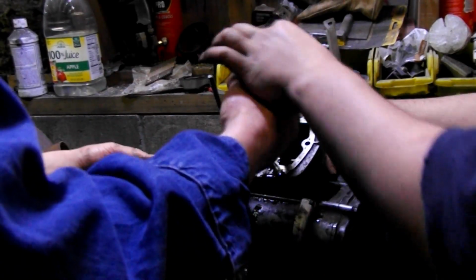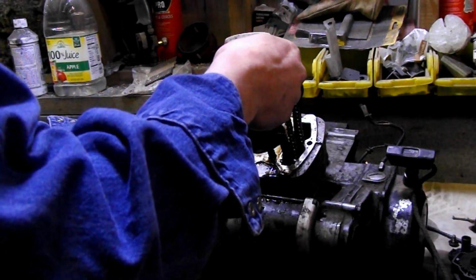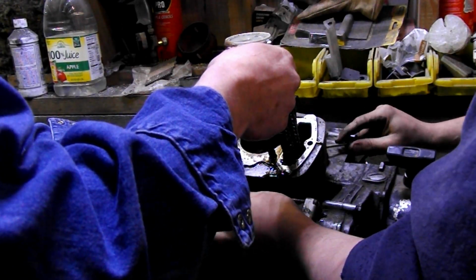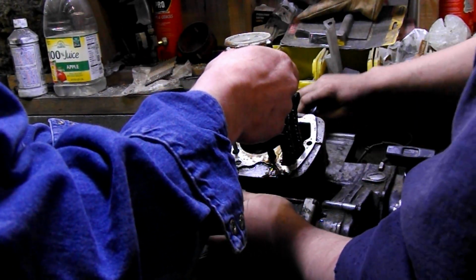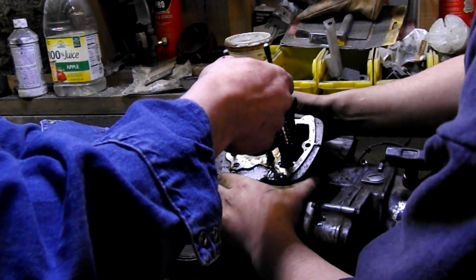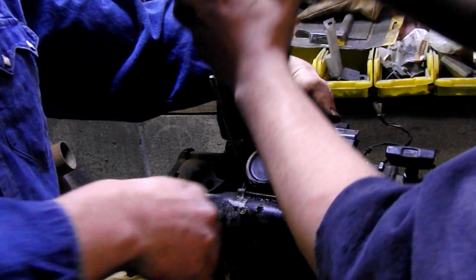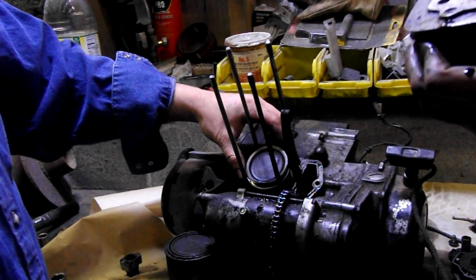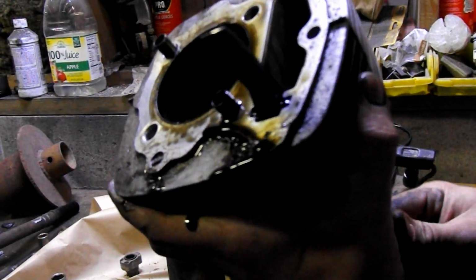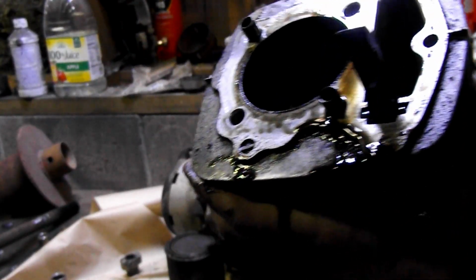Hold the chain. And the whole cylinder is held on by the power of super glue and some kind of superhero, probably. If you're prying on it and you happen to break off one of these cooling fins, a little chunk of it, it's just going to be ugly. There's not going to be any kind of serious repercussions later on. Now when you take this off and you're putting it back together, this right here will sit in this little groove that is made for it. Make sure that's back or you'll blow up your engine.